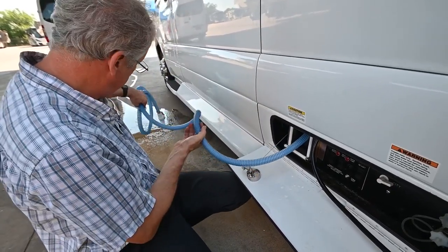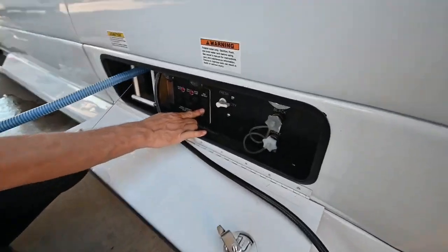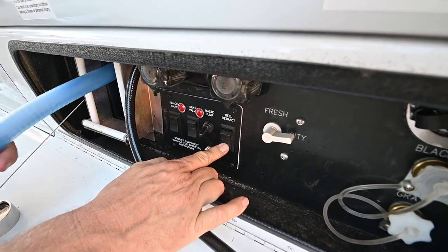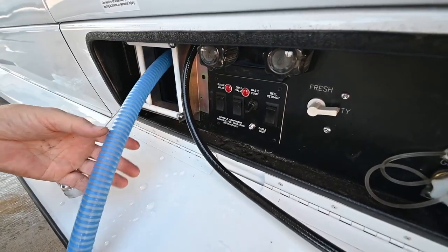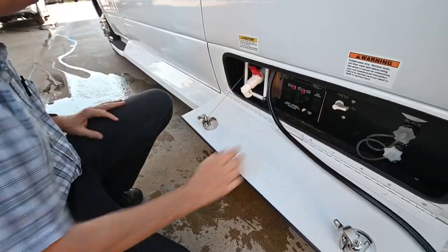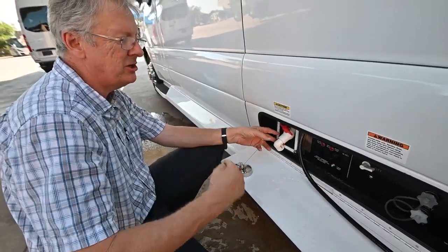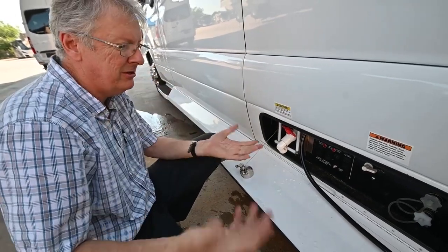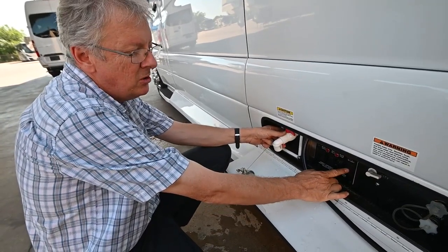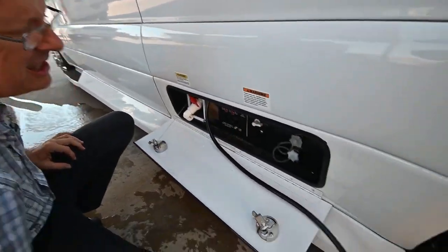You'll find those accessories at all your RV centers. When you run this hose in, go left and right - you don't want to kink the hose or bundle it up in one position. Shut this off and run it in carefully. Don't pull this line all the way out and then run it in the opposite direction - that's going to fold the line over and kink it and you'll have to replace it. Be very careful when running this out; know which direction you're going. The top button extends the hose out and the bottom retracts it, and this does not have a lock on it.